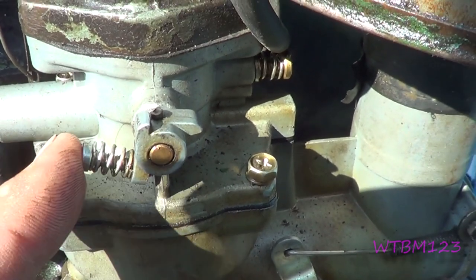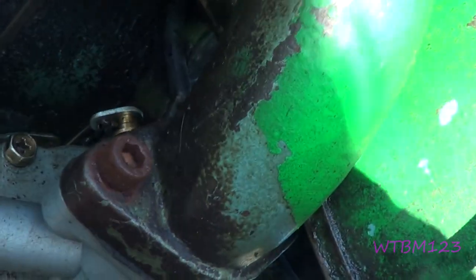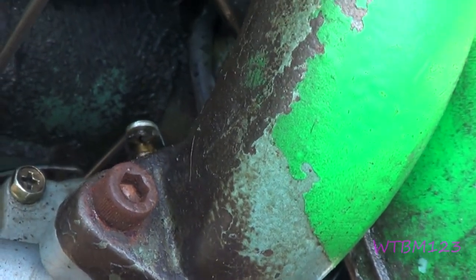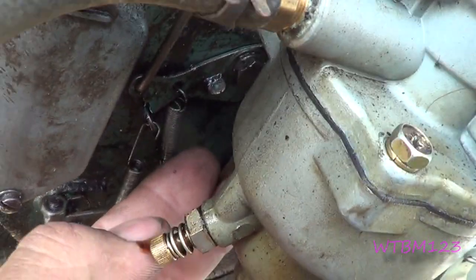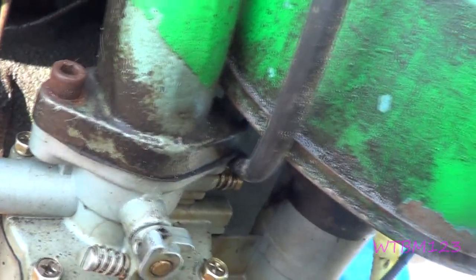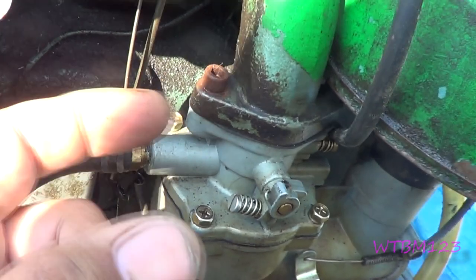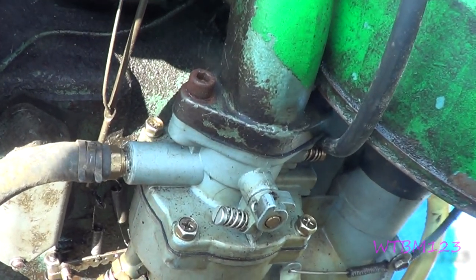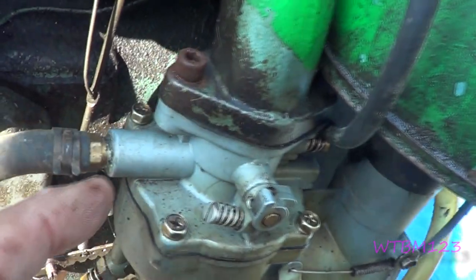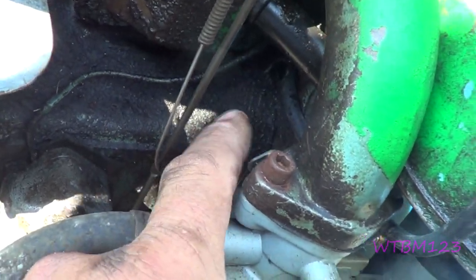When I got this thing, it wouldn't run right — it would just run wide open. And if you see the linkage back here, how it goes up whenever it gives more fuel, this rod goes up in the air. So I had to take the shaft out of the carburetor, flip it around, and put it back on because it was clocked in the wrong position. If you have one that runs wide open, check to make sure this sticks out and is over onto the exhaust side, because it's got to work the right way.